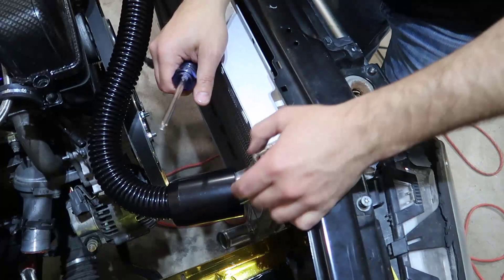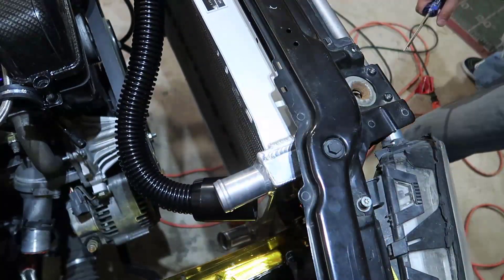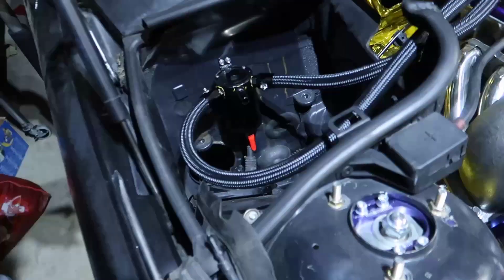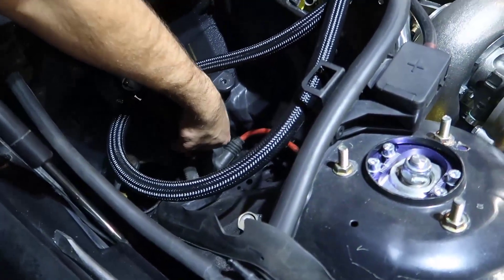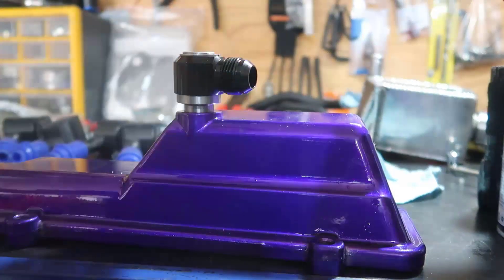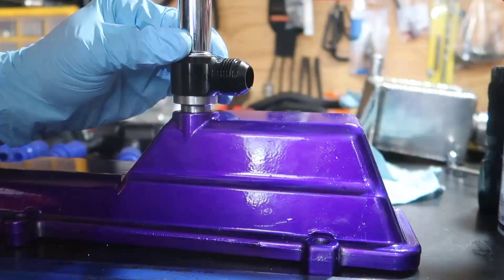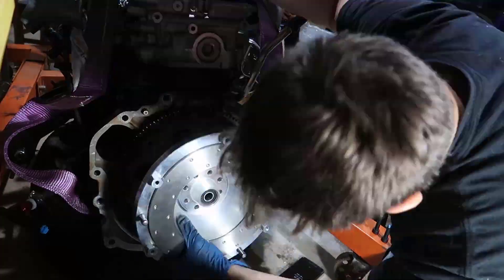After three flex hose connectors failed me, I cut silicone hose to size, fit the flex hose inside the silicone hose, then clamped both — and you're good to go. Can't forget the catch can — got one from eBay with two inputs and one output, one input from each valve cover. To attach it to the valve cover I used a swivel banjo from Radium.